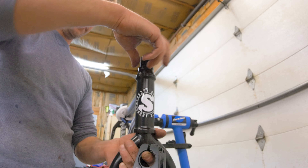Did I need to put my brakes on first? I would put the brakes on before you put your wheel on because it's easier to get to everything. As far as lining up brake pads and stuff, you definitely want the chain first. What's cool about these brakes is that they use a single spring in the center of the brake, so all you have to do is tighten those bolts down and make sure the spring's connected and they work. That's sweet. You don't have to worry about spring tension at all. Oh, that's nice.